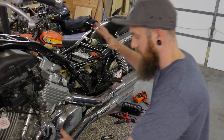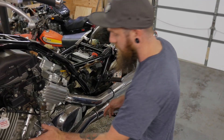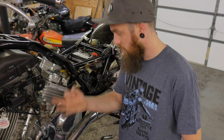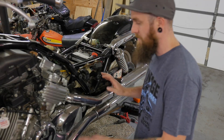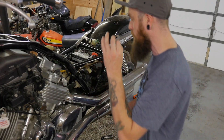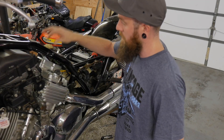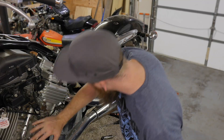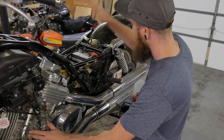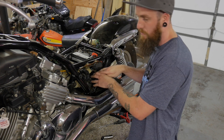Here we have a 2002 Honda Magna. The charging system they use — the regulator rectifier is down here underneath the battery box, and our stator is right here. It's usually the same as many other bikes. This uses a three-phase charging stator. We have three yellow wires that come out of the stator. Each one of these is putting out an AC voltage that has to be transferred to a DC voltage so the battery can be charged — AC to DC — because of the cool stuff that takes place inside of a regulator rectifier.